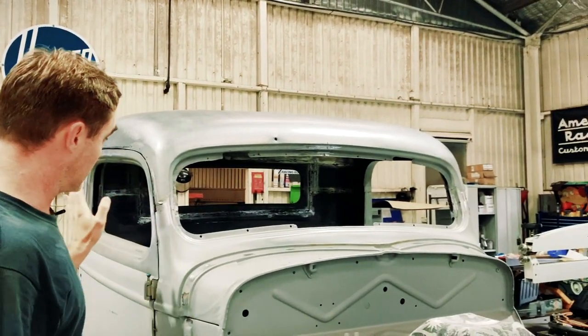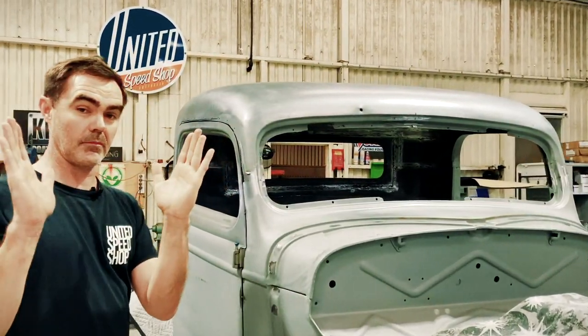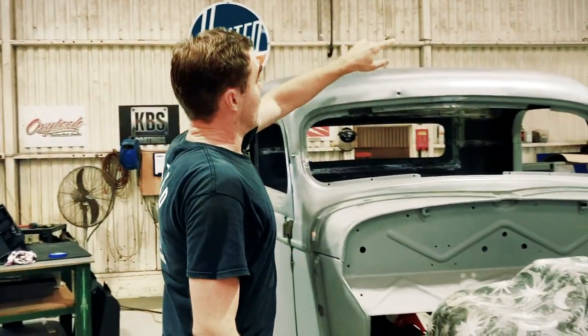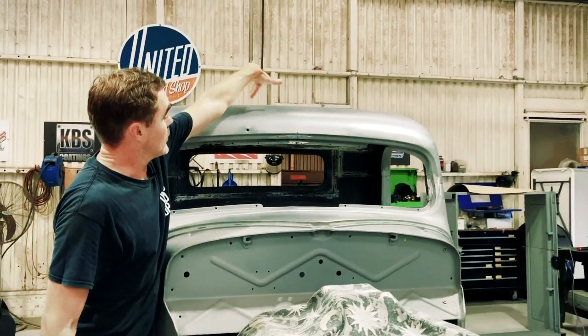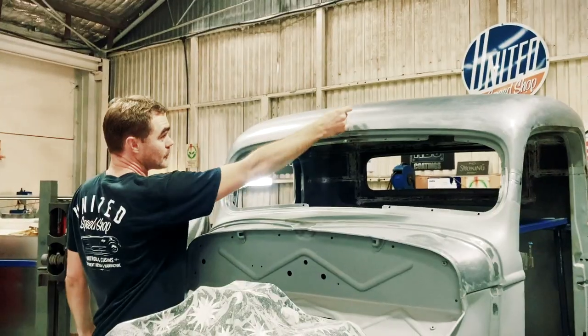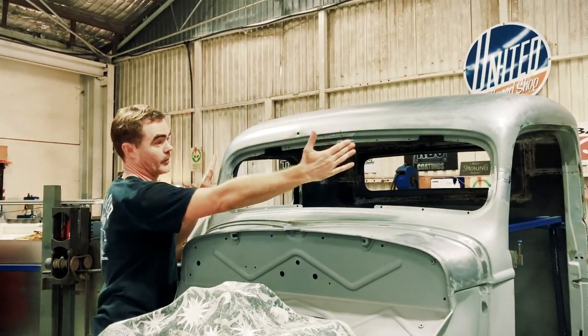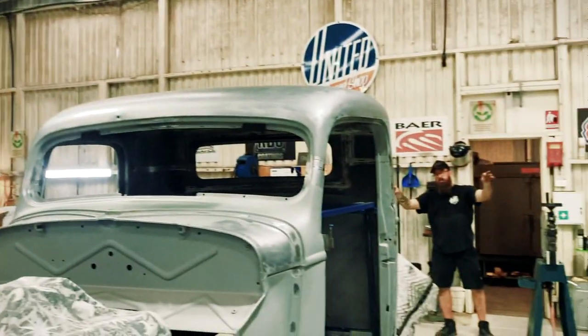Then we realized that in this particular model the pillars were slightly leaning out like a bit of a loaf of bread. So from here to our sideways cut line or widthwise cut line, we took 1/2 inch spanwise from here to our cut, narrowed the front half of the roof and brought the pillars in for a nicer look.